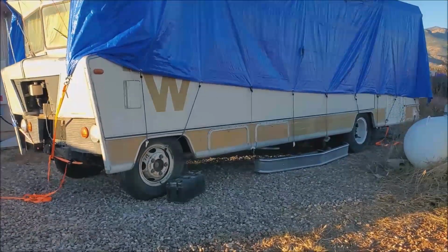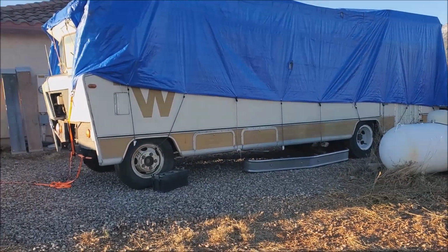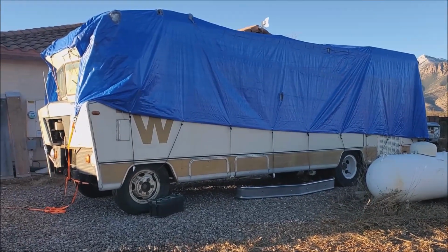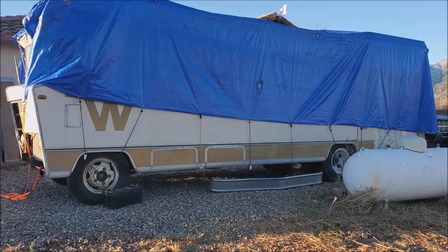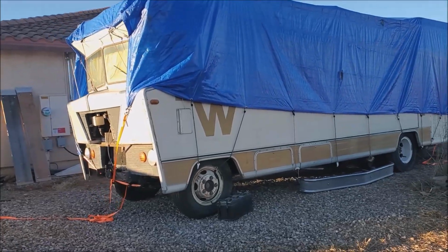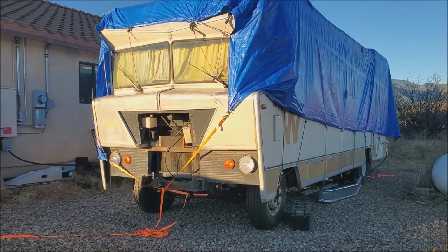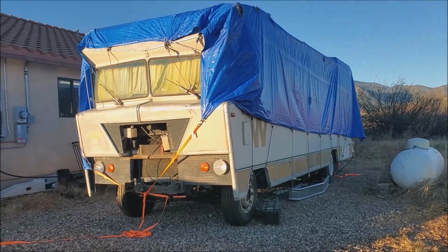Additionally, it's a 17-inch tube type tire. It's about 34, 35 inches tall and really skinny, so there aren't many modern tires that are available in that size. What do we do about that? Okay, well, we got brakes that are going to be hard to source. We've got tires that are hard to source, with steel wheels that are difficult and dangerous to work on. Sounds to me like we should be swapping stuff, wouldn't you say?